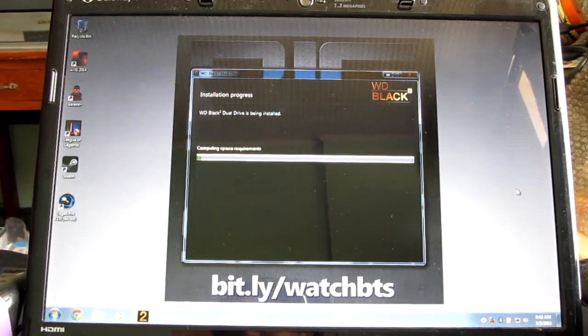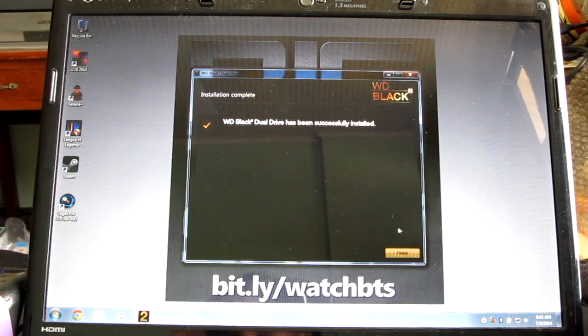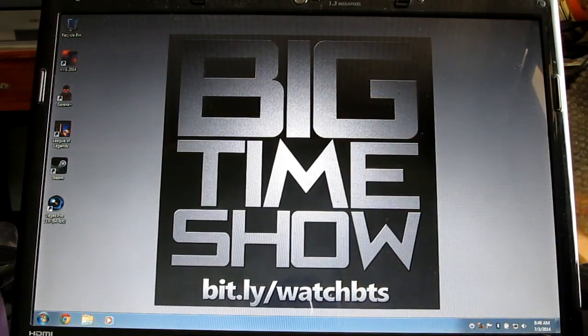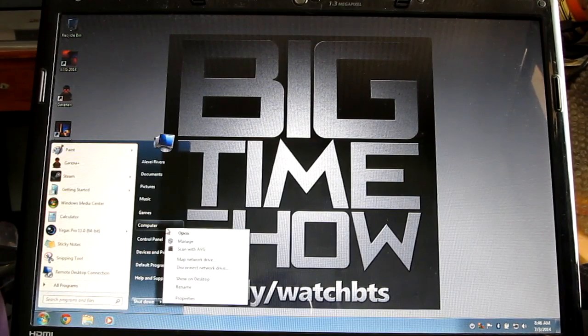I do suggest that before you install Windows, you should switch your SATA mode in the BIOS to AHCI, particularly because it won't load the AHCI drivers if you don't set it to AHCI in the first place. If that happens, you want to go to Microsoft, search for the AHCI error, and they will give you a downloadable fix.